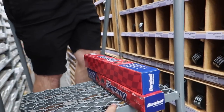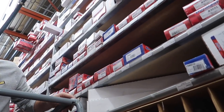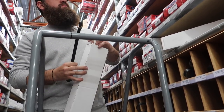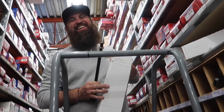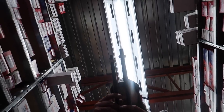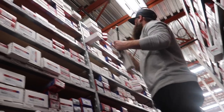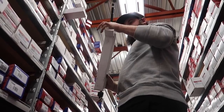We're at AutoZone right now checking their tie rod sizes. The Maxima was literally the same length as what we just had. Rather than just searching up random cars, they actually let us in the back and we're just measuring tie rods, because the tie rod is a pretty universal part — it's just a matter of the length. Long story short, we're playing major parts roulette trying to figure out tie rods that are longer than what we already have, just opening brand new boxes. Found one that's about a half inch longer with the same thread pitch — we're grabbing both of them.